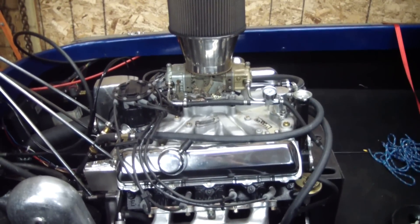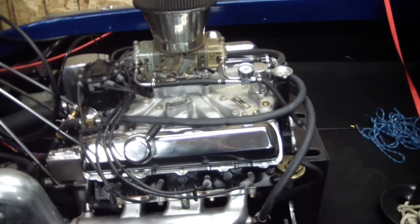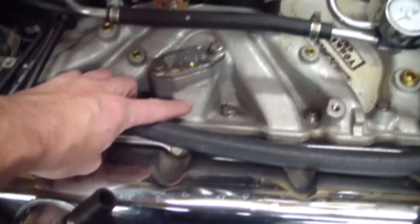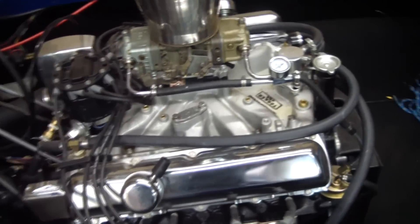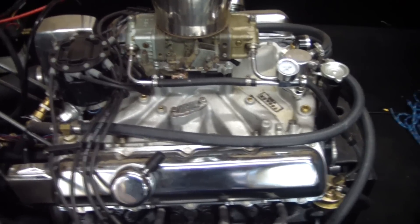Here's a look at the intake. I clear coated this intake back in May of 2011, so it's been about a year and a half. I would like to note that the heat risers were blocked off in this intake manifold. This engine is in a boat, so it was cooled by lake water, so it never really got that hot. And really, this probably isn't a good idea for a car.